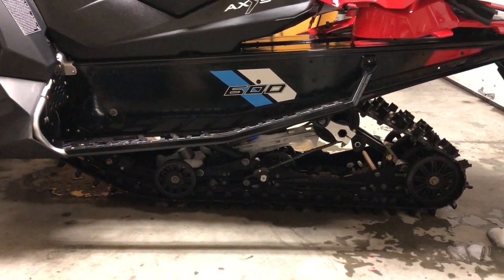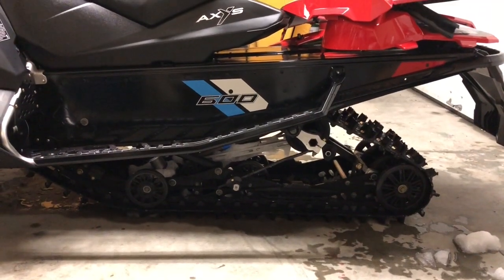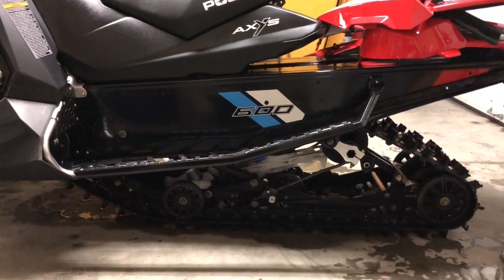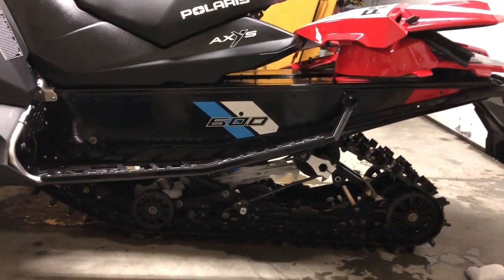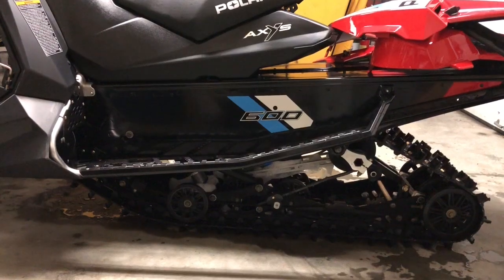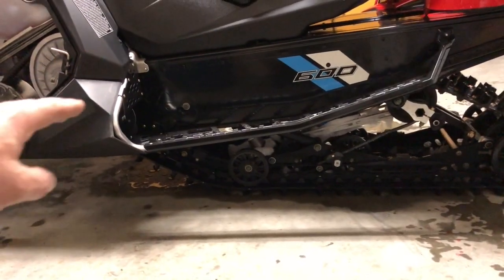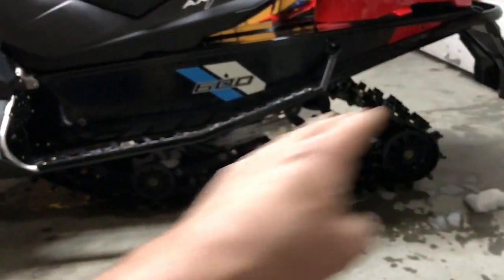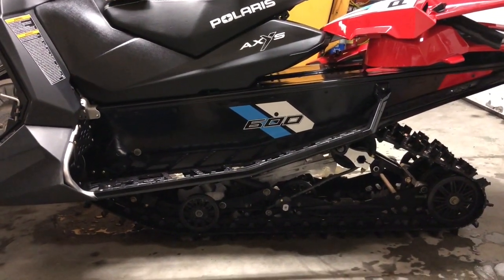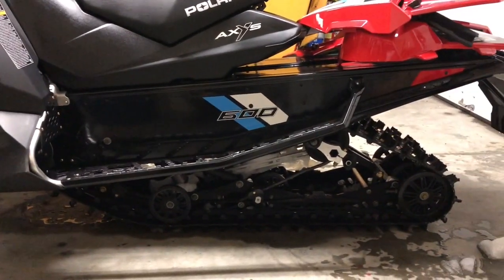What's kind of neat, back in the 70s, when the TXs, TXLs, TXCs, they had a deep tunnel. They're actually comfortable to stand up on when you're riding those springers. When the Indies came out in the 80s, they used the same deep tunnel. They ran that till 85. When the 86s came out, they went with the taper tunnel. The taper was a constant slope, and they were great for running through deeper snow, but they weren't quite as comfortable to stand up on. They had really short seats back then, so I like this compromise that they did here, and it works.